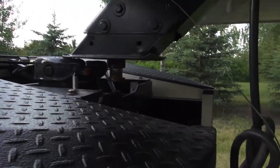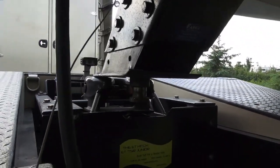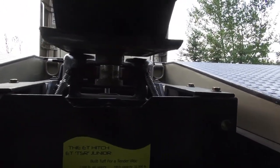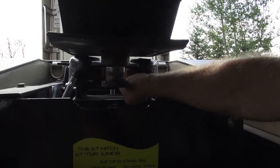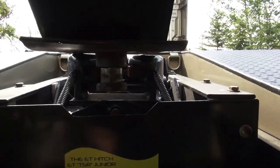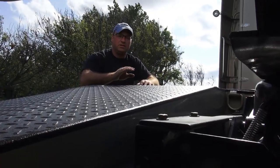Come around from the back — a spotter is great to have helping you do this. If you come straight on, you'll see that this pin is heading straight into those jaws behind. And from this angle you can see that the plate is just floating above the surface of the head. So now we're ready to hitch up the final stage.